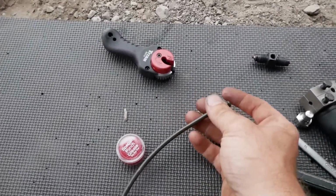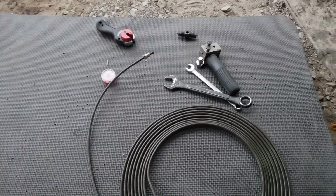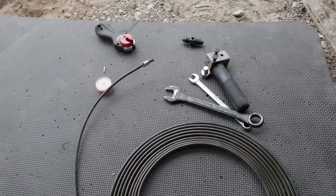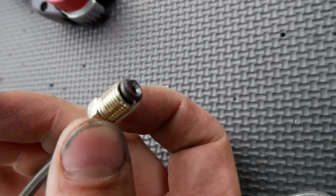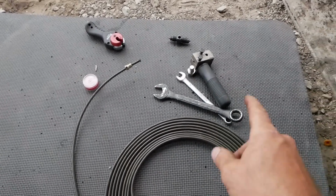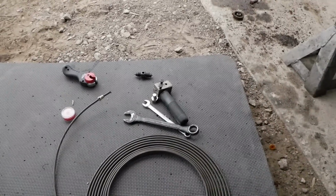You know, working with rusty lines, dreading doing brakes all the time, I will literally just rip everything out and run new lines because it's so easy and it's just cheap, safe insurance. So you got good working brakes. And it makes an absolute perfect double flare every single time. It's amazing. I got one for 3/16 for running basically all your calipers, drums.